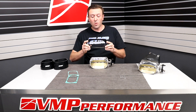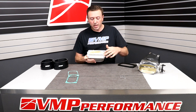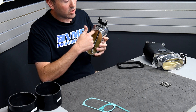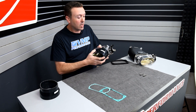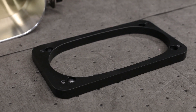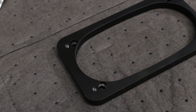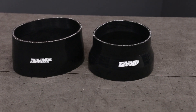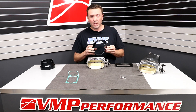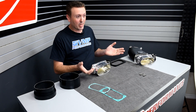When you go to install this throttle body you're going to have to use this adapter plate. There are some things about designing throttle bodies — you can have this bore size but if the bolt pattern is too close to the bore, you can't get the bolt in there because you need a large enough flange to get the rubber coupler on. That necessitated a different bolt pattern. We made it really simple this time because the bolt pattern is nearly on top of the other one — you bolt this adapter plate down, use the provided gaskets, and this thing bolts up super clean and centered. We also have silicone couplers available: this one adapts to a JLT 148, this one adapts to a JLT 123.